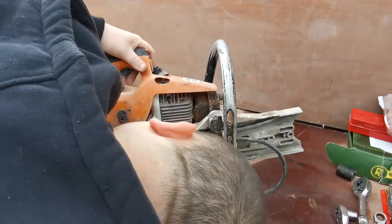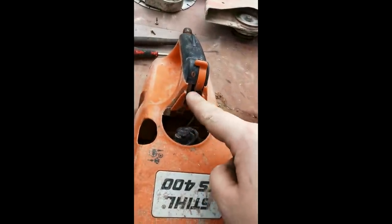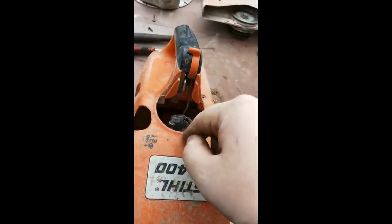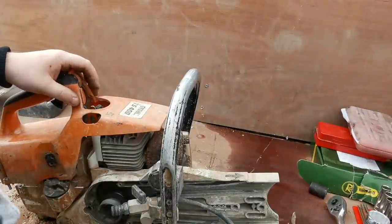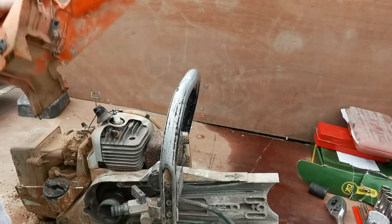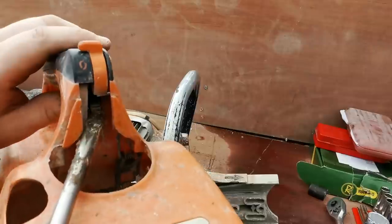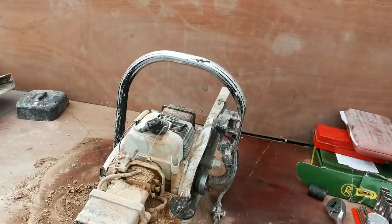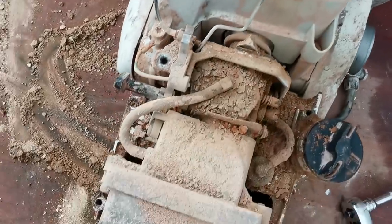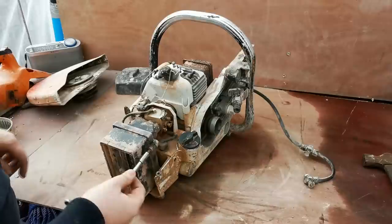I can't see what's actually holding that on there — I think it's to do with this linkage here. I've got to get hold of this metal tab and it's actually just clipped into this black casing here, so I've just got to pull that out. What I did was just get a screwdriver just behind that clip and pulled it forward, and it came out. That's your actual throttle bit — it's all new to me this. If you're looking here now you can see how much crap is in there — it's full of thick dust, all wet. I'll take this into the log cabin and give it a blow down with the airline. It's come up a lot better — this gets rid of all the crap.